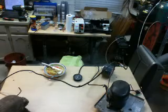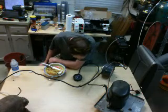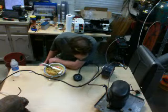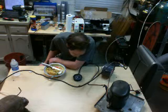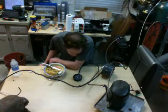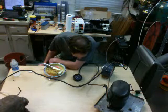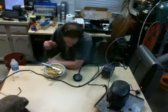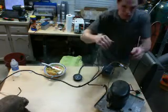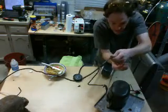Okay, I'm back. So we're pulling 28, almost 28 centimeters. Oh, that's okay. That's inches HG of vacuum. It's like 27 3/4. So now let's check each one of these, if I can get it off.